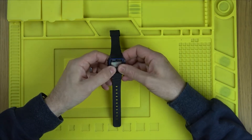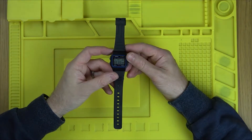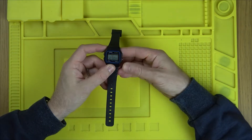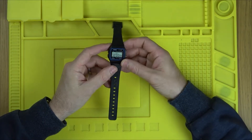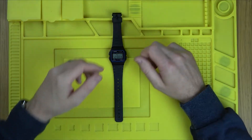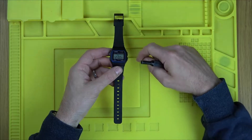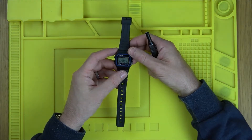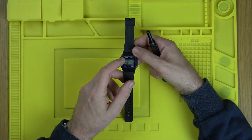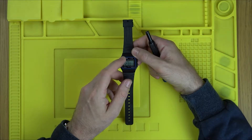Right now you can see that it's not doing anything, but sometimes it will come up. So it seems to be a little bit all over the place. And now it appears to be working, but it isn't right because you can see I had to press the buttons to get it going. So it's going to be something straightforward. Also you can see that the time's just started because it only started working 30 seconds ago, so it's not just a display issue. There's no power getting there, because if it was just a display it would read a different time than just turning on now at 12 o'clock.